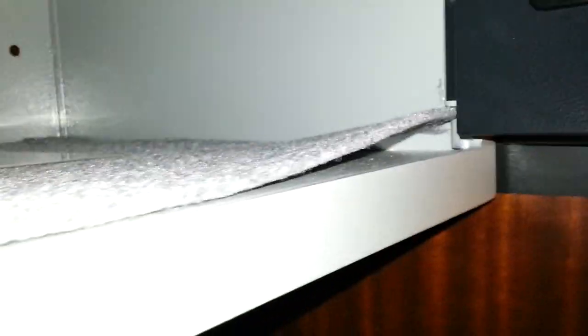If we come around to this side — this is the back of the door — one thing you notice is that there's a little panel here. I haven't tried to remove it because it's not mine, but on many safes I've seen on YouTube there's a button here, like a little battery door with a button to reset the combination. On this one there isn't one exposed. I assume there's something like that behind this panel, but it's protected. The door is some kind of relatively thick plastic with a security torx-looking fastener. Around the corner, that's actually the battery pack right there, so this must be some kind of maintenance port. The batteries are outside the case, and all of the edges of this door are solid, so there's no way you could shove a wire in and poke at a reset switch. That's one of the standard vulnerabilities addressed here.